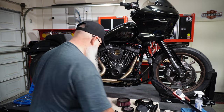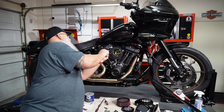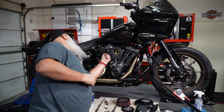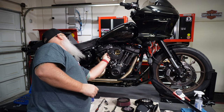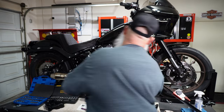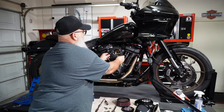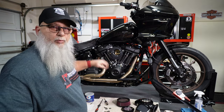Those are just hand tight. I'm going to take a washer and feel back here between this mount to see if I have any gap — that'll tell me if I need another washer. That side's good, and that side seems good. You can use a feeler gauge, but we're just going to use the washer. Everybody else said they only used one. So now we'll go ahead and tighten down the breather bolts and then the center bolts as well.